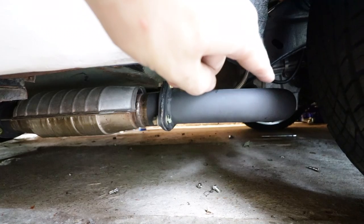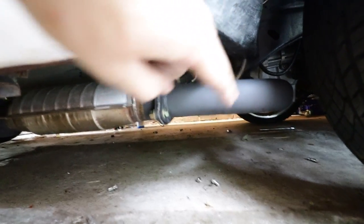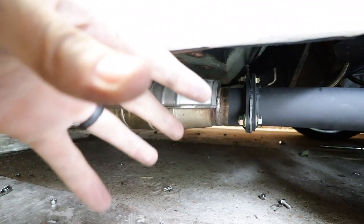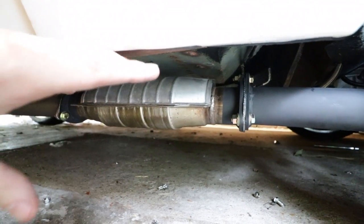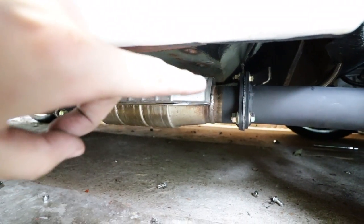We have a flange down here at the bottom of the O2 housing, a wraparound pipe that gets us around the X-frame of the car, and then two flanges that bolt in the catalytic converter. They kind of smush but don't burst out, so they're not as soft as you think once you start to compress them. Everything's at least 20 foot-pounds. And just like that, a week and a half later, we have it back together and working.